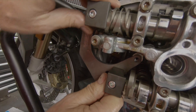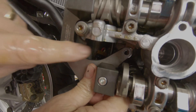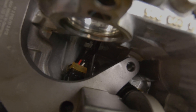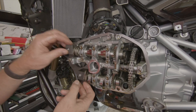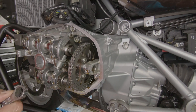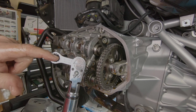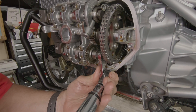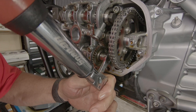Both cams are now locked in place. There's a small six millimeter hole in the jig where we can run in a bolt, tighten up and hold the alignment jig to the cylinder head. Once the alignment jig is on, we go ahead and tighten up the bolts that hold the cams on. Remember that with the torque adapter it has to be 90 degrees from the head of the torque wrench. I'm going to set these to 65 Newton meters — check the torque sheet attached to the description section in the video.